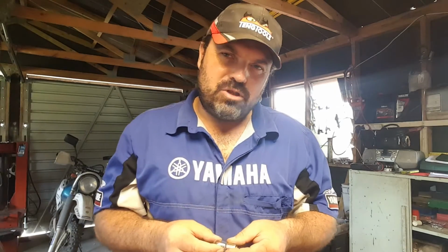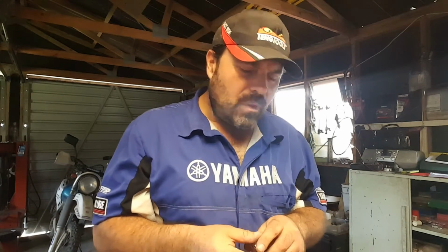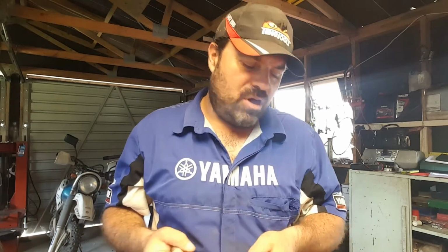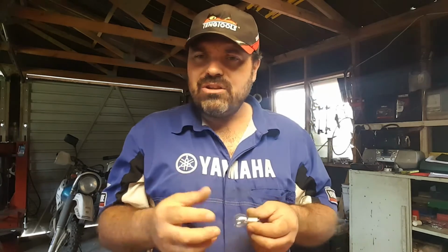Okay, so my apologies, it wasn't that easy to see. I've done the best I possibly could on that particular car. Some cars are much harder to get to, some cars are a lot easier. Some vehicles, you don't access the lamp to change the bulb from inside the boot. You can actually unscrew the lamp cluster off the vehicle. There's a couple of external screws. Sometimes they're on like little poppers and you've got to drive it off. Again, it's not always easy.